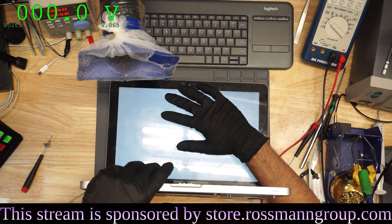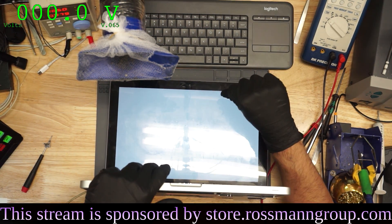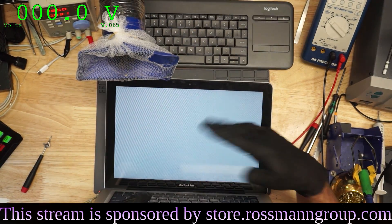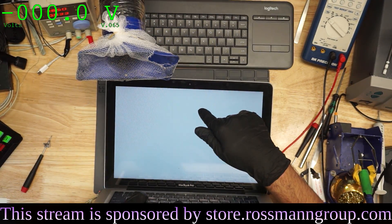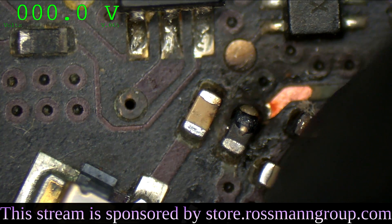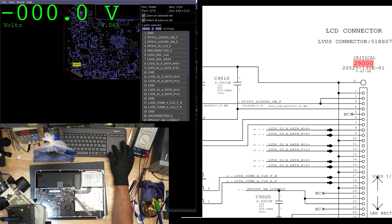So this screen — it looks like it's turning on because you see how it's gray. Well, people will think the screen is turning on, but it's not. This screen will actually turn on even if it has 0.5 volts. Even though the screen needs 3.3 volts to function, you will get this general grayness of it just starting up with 0.5 volts. The screen looks like it's turning on, but it's not. This will especially confuse you if the inductor looks good — here the inductor looks like trash, so it's obvious what's going on. But if the inductor is not blown up and the screen looks like that, very few people are going to check to see if there's 3.3 volts at LCD VDD, and that's exactly what you need to do.